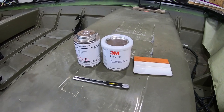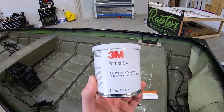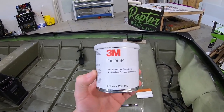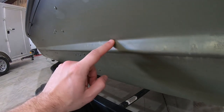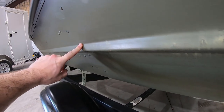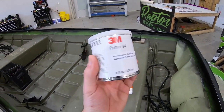A couple of things that you're going to need, which is an absolute must: first and foremost, you're going to need some 3M Primer 94. What this does is it pretty much activates the adhesive a lot more strongly than what the actual wrap adhesive is going to do on its own. You're going to want to put that all around these edges. If you have any crazy grooves like on most John boats, you're definitely going to put a line completely along this whole edge, one on the bottom edge, and all the way around this whole line. You can buy this online, probably get it on Amazon.